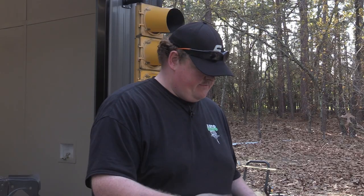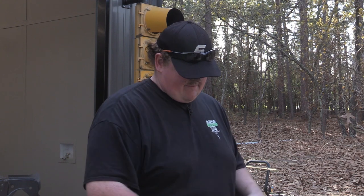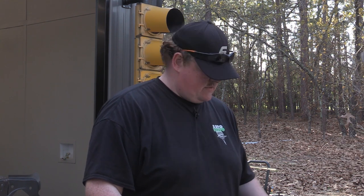Yeah, and you're going to do it with a hot water solution so it'll evaporate quicker, and just to dissolve the oils a little bit better. And then after that, you put some WD-40 on it. Blow dry everything that you can, get every scrap of water out of it, and then heavy coat of WD-40, and then I like to blow the excess of WD-40 off. So, pretty easy. So you'll be out here another 3 hours then? Probably.